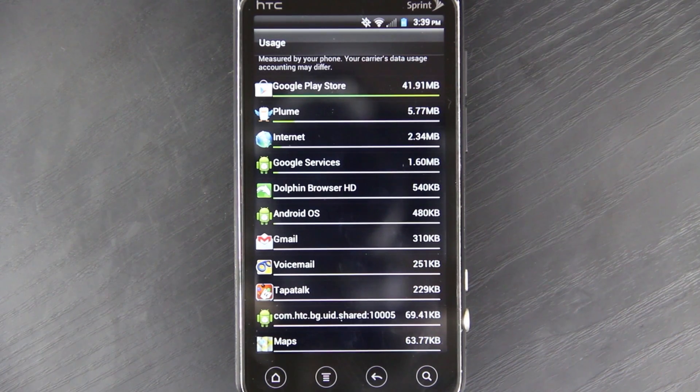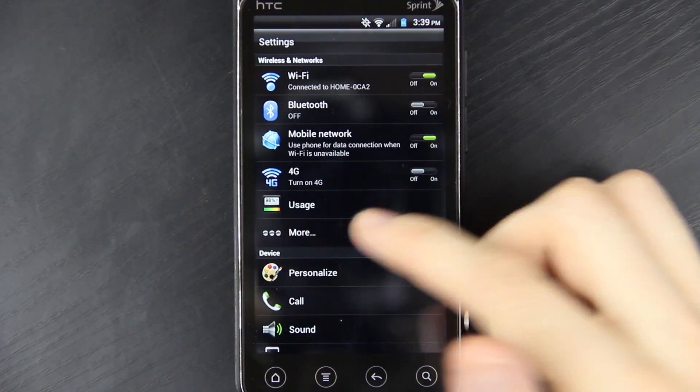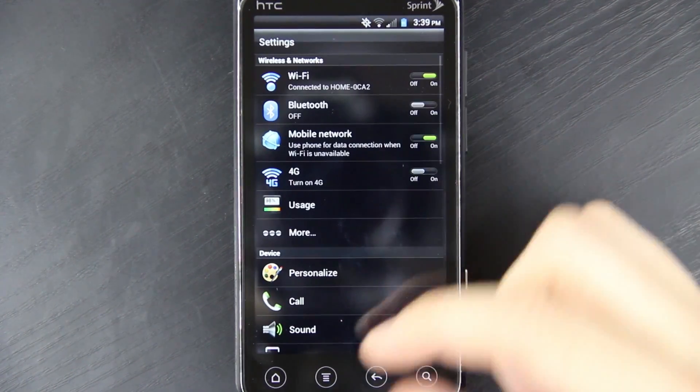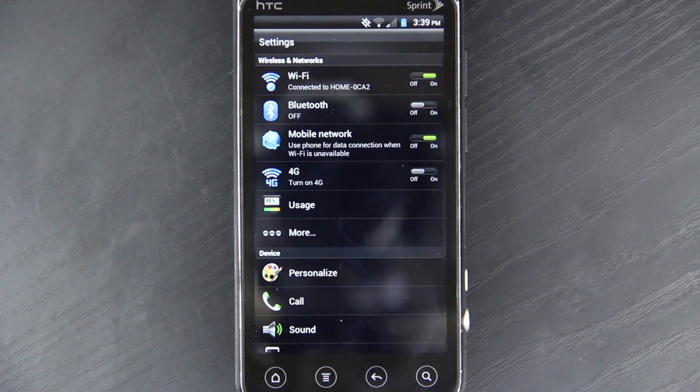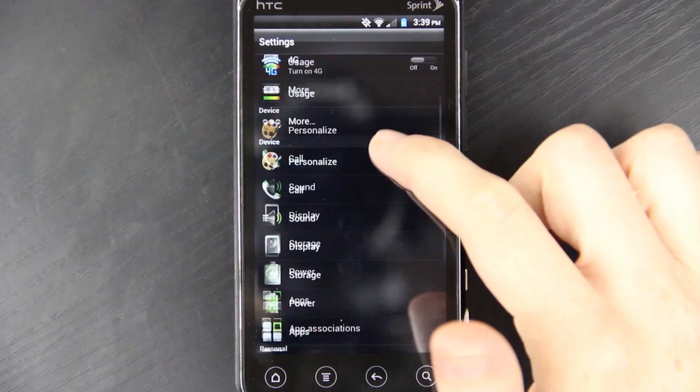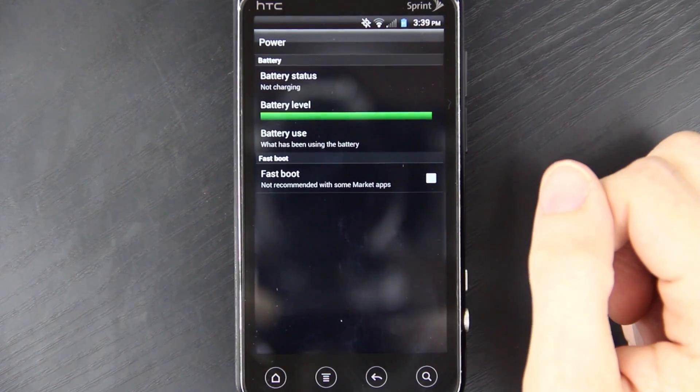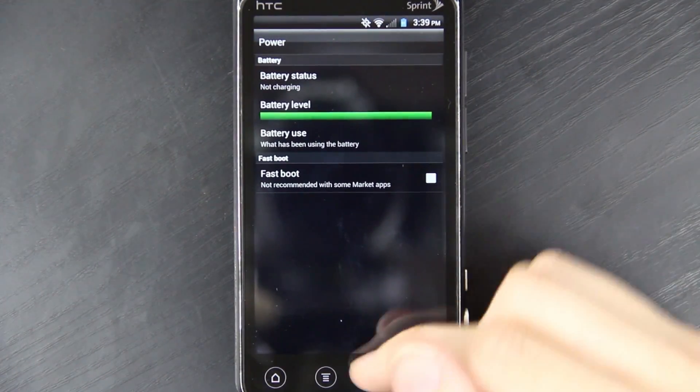Because I'm constantly syncing to Dropbox, Box.net, and Google Drive from Titanium Backup to make sure all my apps are safe and secure. You can use Wi-Fi Tether since this is a rooted ROM — not the built-in one, but the actual app. You just have to change the device profile to Amaze 4G and uncheck the routing fix, just leave MSS clamping checked. One thing I highly recommend is unchecking Fastboot once you install this ROM, because that's on by default. Your phone won't actually fully shut down and reboot — it'll just kind of suspend things and reboot quickly.